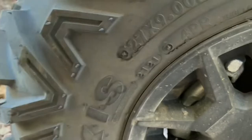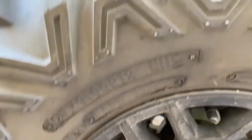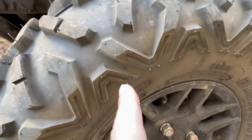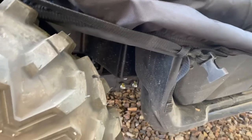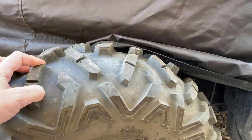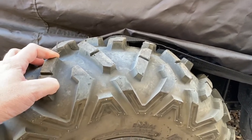The tire size is 27 on the front and the back. Stock was 25s — the same size that came on the Honda Foreman. Some people say you can go up to 28, and honestly, looking at how close it is, it might not be an issue. I know someone said they put a two-inch lift kit on theirs and it was no problem. But yeah, I'm pretty happy with the 27 decision from the 25 — I think that was a nice increase.